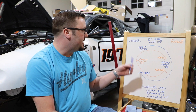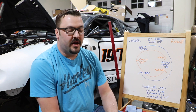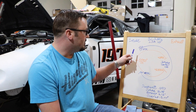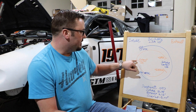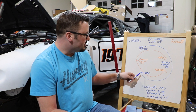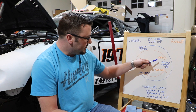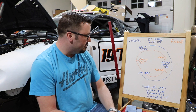I've been fiddling with it now for a day or so. I've got the cam specs for what they're supposed to be written right here. They're Brian Crower 280s. I actually emailed Brian Crower because I've had these cams for years and he got back to me right away. So this is what I'm going to be measuring today: intake open at 50 thou, close at 50 thou, exhaust open, exhaust close at 50 thou. Exhaust center of 114 degrees, intake center of 106, intake opens at 3 degrees before top dead center, closes at 35 after bottom dead center, minus 6 before top dead center on the exhaust close, open at 42 before bottom dead center.